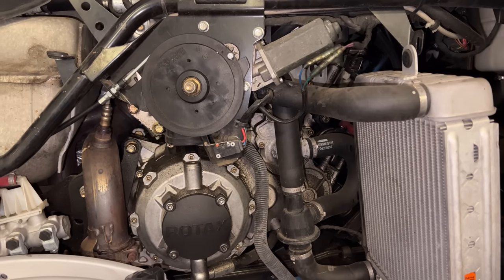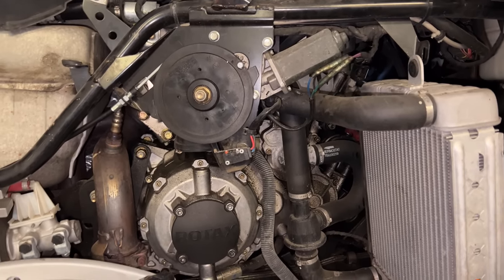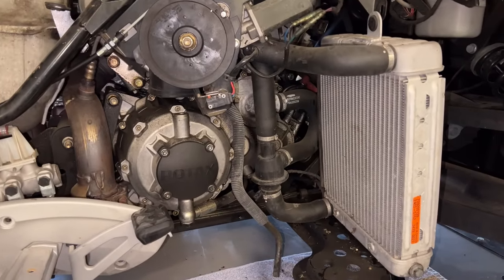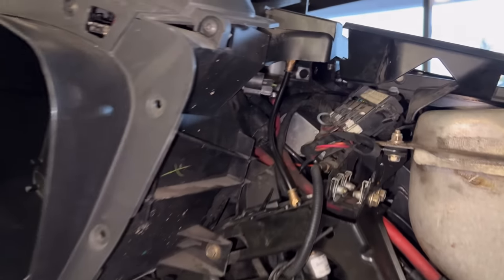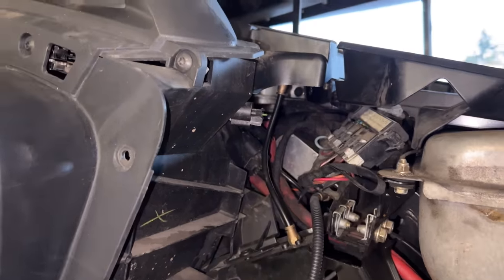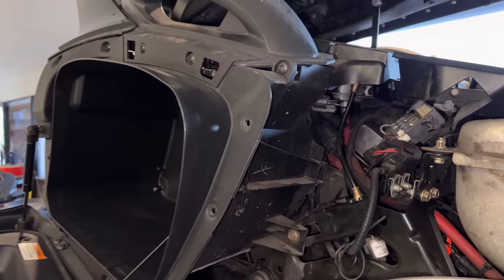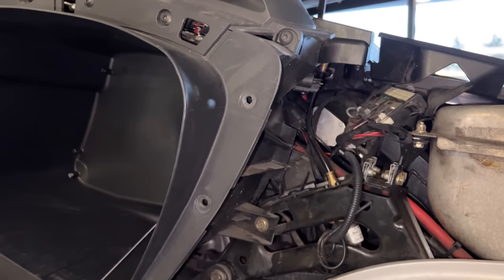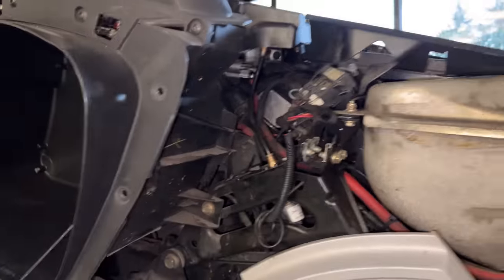It's kind of like you do it in your sleep now. You're not really seeing them anymore — most of these things are long gone by now. Anyway, back at it — thought I'd just chit-chat for half a second. The ACS pump: BRP says it takes about half an hour to put that thing in. Yeah, they must have used a flat rate from something else, because you gotta take the whole rear trunk out. There's a plastic plate, and the bolts that clamp it and hold it to the frame are down in that plastic — you just have no access to them at all.